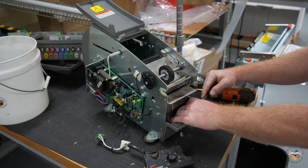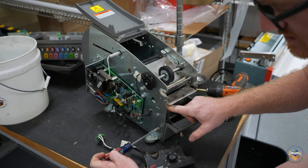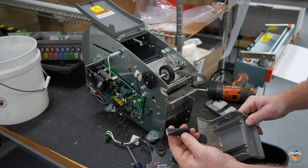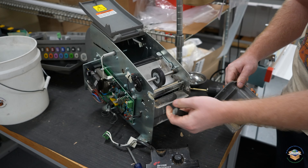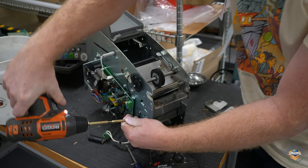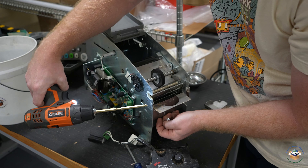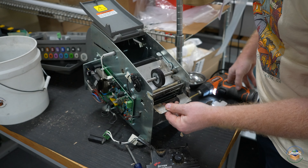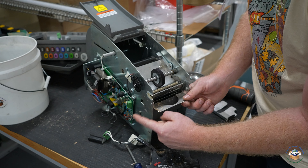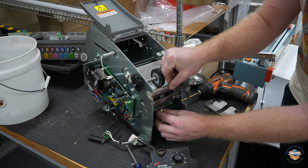There's one on each side. I'll start on the right side, push it in, hold it out, then get the other one out. First sign that something's up is this — it's on the outside of this baffle plate, and that's unusual. Take this baffle plate off. You may find that yours has got another screw up here — if you've got three screws on your baffle plate, one of them is going to be short, and that short one goes on top. You've got an older machine if you have that. Most machines won't have that. And this is our culprit right here.